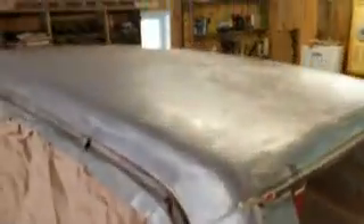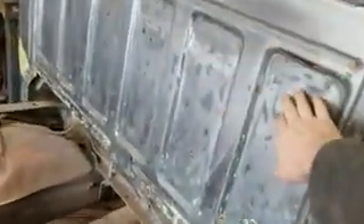We'll do whatever we have to do. I ended up stripping the whole thing. This is pretty much completed — you can see a nice sheen. It's just dirty now. I put the Ospho everywhere yesterday to treat it so it has that kind of sticky stuff. I put most of the effort on panels we're actually going to see, like the exterior here in the back and the top. In the inner panels the box kind of covers it and it's just so much work. I'll put a bit more sanding into it but I'm not going to go crazy trying to get rid of all the little scratches.